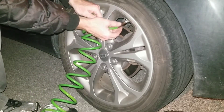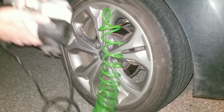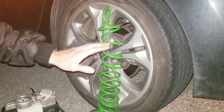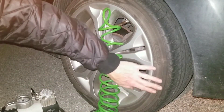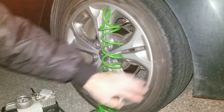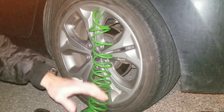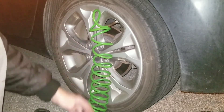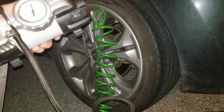Thread the fitting on here and look for your pressure. You can look inside your door or glove box. If you have a different tire than the stock tire, you want to look on the tire sidewall — it'll say max pressure. Check it with the gauge; depending on what gauge you have, a digital gauge or the gauge on your pump like this one — as you can see, this one reads around 30 PSI.